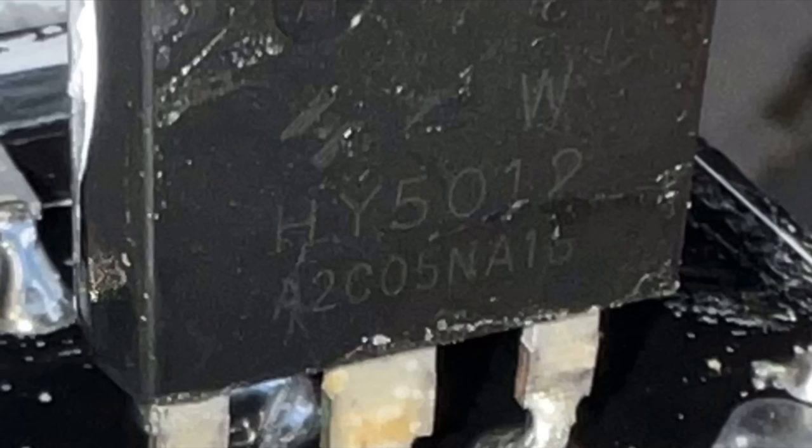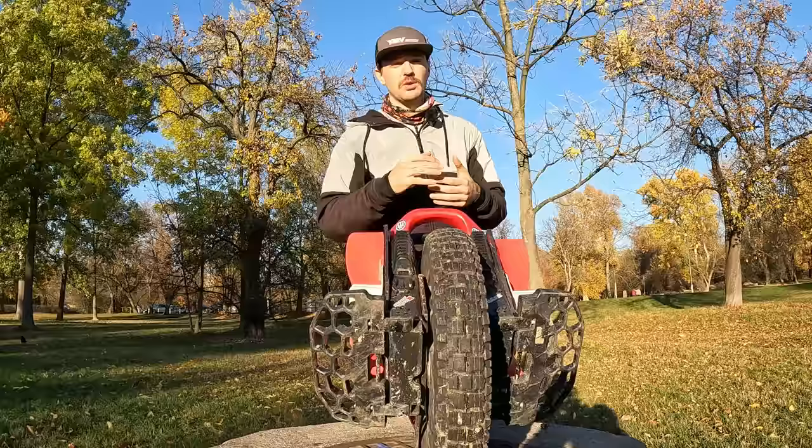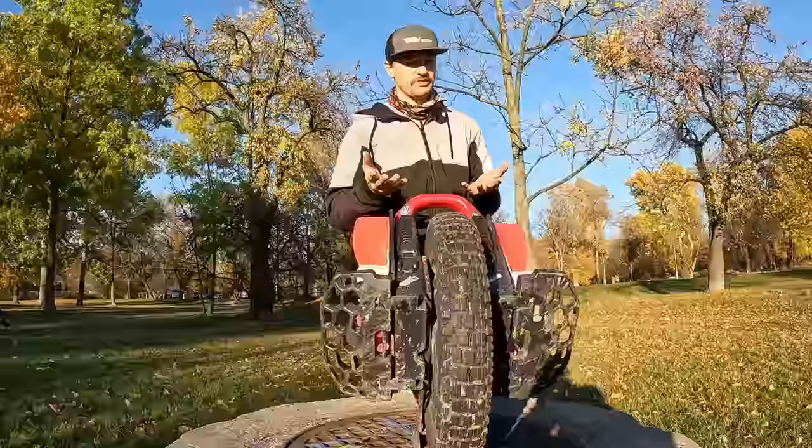Now, they did a lot of tests apparently, and those were more reliable than the actual 150 volt counterparts, but you have a 126 volt wheel. When you're braking, this voltage could even go up on the board. You choose to have 125 volt MOSFETs. I mean, just the numbers don't add up. I don't know at which point it comes to failure with those MOSFETs.